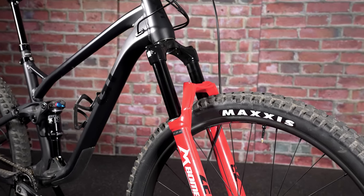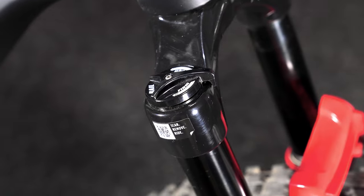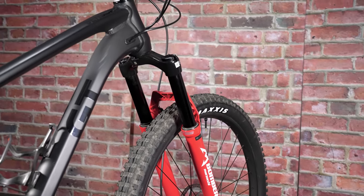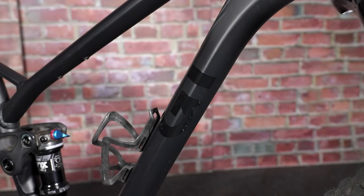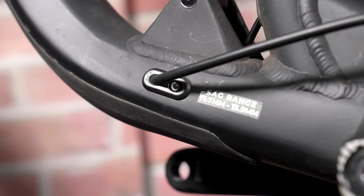Another thing to look at is the fork. Can you explain the experience with this fork and how it surprised us? This has a Marzocchi Z2 fork with the Rail damper — we'd had pretty good experience with this one before. It's pretty simple internals but typically effective. But this one developed a little bit of bushing play and also just didn't feel quite as effective at sucking up the hits. It was inconsistent — sometimes nice and quiet and supple through stuff, and then sometimes it would feel square and edgy. Something to keep in mind, though not something you'd swap out right away because a new fork is expensive. The frame itself was actually quite quiet — no bolts came loose. It has locking cable ports so it's not going to rattle in the frame, which we didn't see on the other bikes. That's a nice detail.